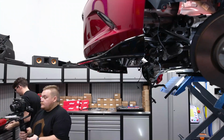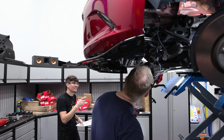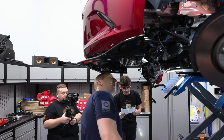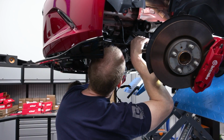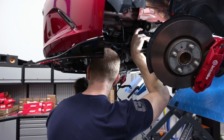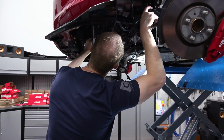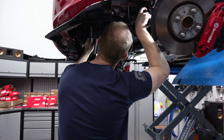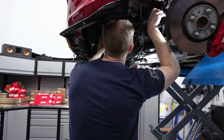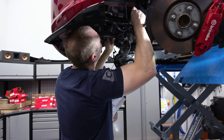All right, now what are we doing? Well, I got those out. Sure I can't get this out just like this? I don't know. There's a reason why they made these instructions, Matt. Oh, yeah. I live by my own rules, Bryce. Disconnect all of the wiring on the shroud, both from the shroud and from the mating connectors. Just disconnect any plastic anchors for the wiring as well. Unplug the sensors to the AC line as well. It's kind of weird that we're disconnecting the stuff up here when the sway bar is back here. Yeah, I don't know why they require this.